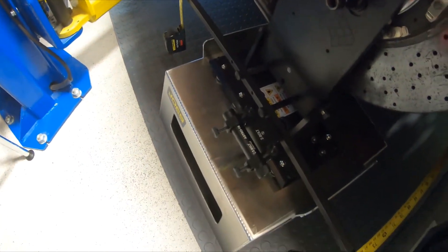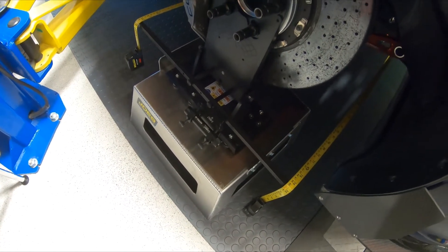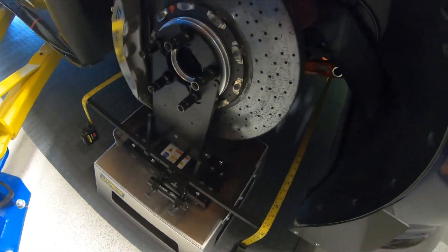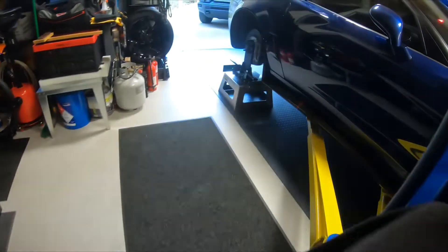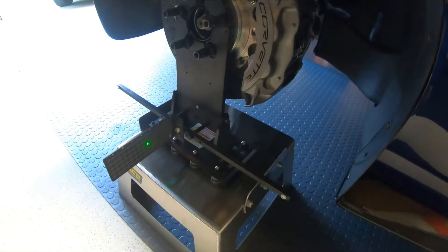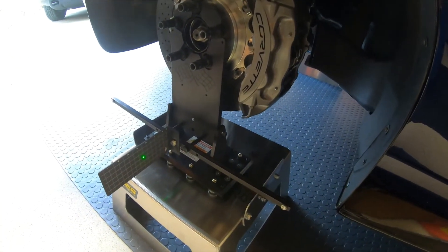The lasers are a nice option — they have lithium ion batteries and they're rechargeable. We've already done the front. We run about three degrees negative camber in the front and about a sixteenth toe out. We run about 1.8 degrees negative in the rear and about two sixteenths toe in on these cars to make them steer better.